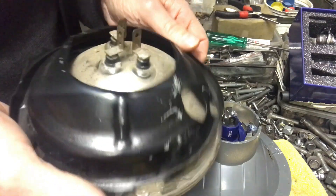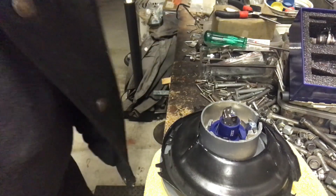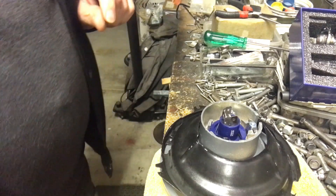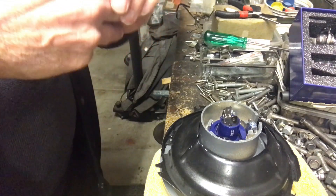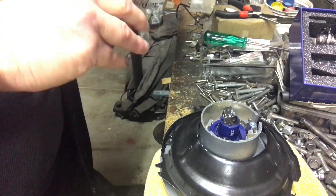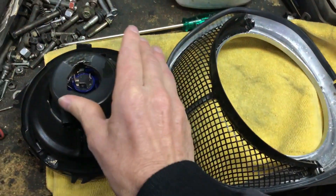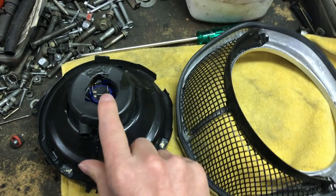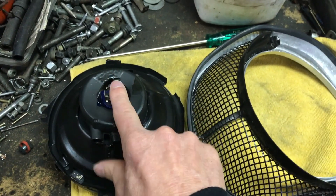That's how the old ones used to sit. You have to open them up for the new type light. Now we've got the new LED light in there, and we're going to fit it on the left side of the vehicle — I've already done the right side earlier. I've just put this rubber boot on to seal it as much as it can, because that's an aftermarket one that was all closed and I had to cut that hole out to let the plug fit.